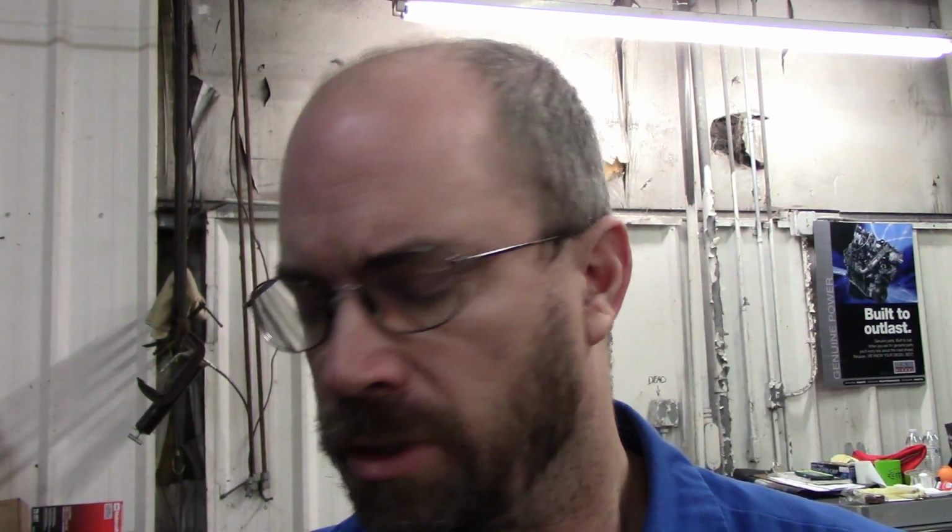We had a little bit over 100 amps. Usually, general rule of thumb is 20 amps a glow plug. It's pretty warm in here. The heat's been on. I turned it off when I got here. It's cold outside, but it's warm in here. What's that? 12 amps a glow plug. So it's pretty good. It's not too bad at all.